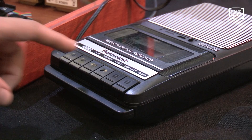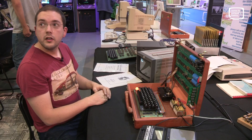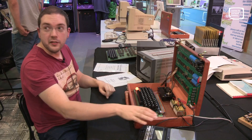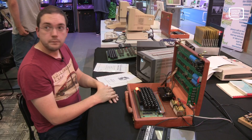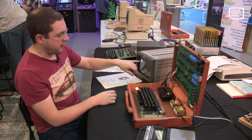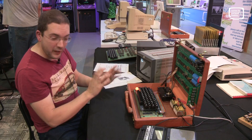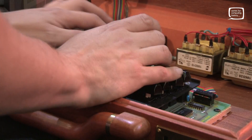You enter the memory address range, then R to read into memory — W would dump it back out. Then press play and it loads. The only feedback is a small LED on the cassette board, which is a bit temperamental. If it doesn't load it's usually a volume issue — standard 80s mess with the volume. The code is just under 4K, closer to 3K. You know it's done when you get the backslash prompt back.